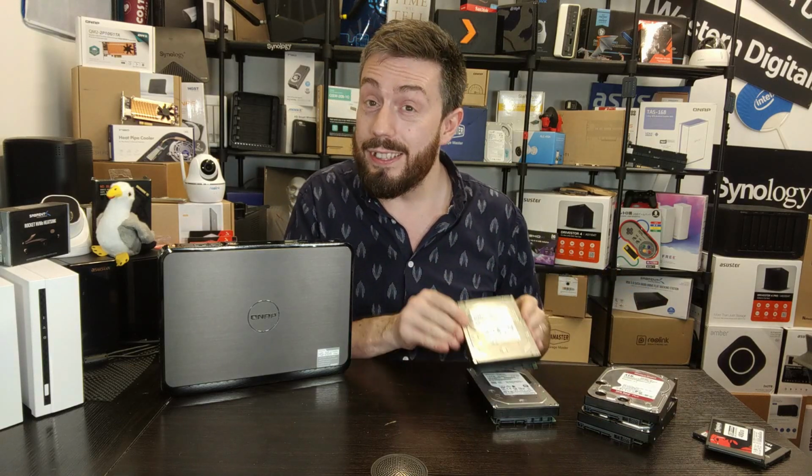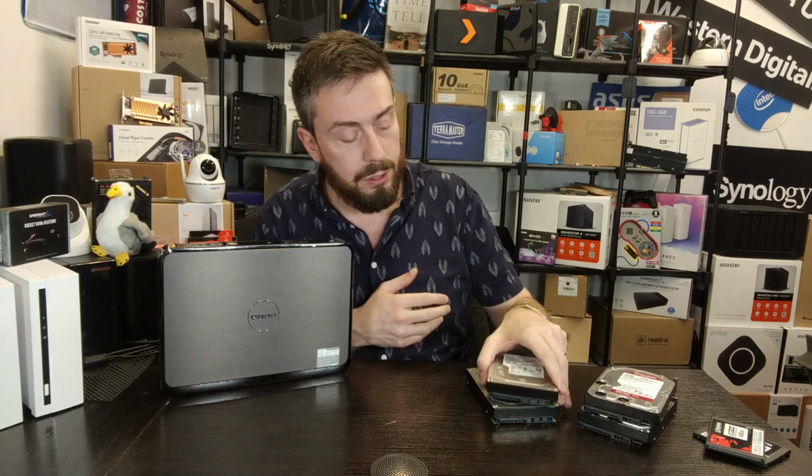And I'm going to be looking at data center class 10 TBs, which these days, given the way portfolios for a lot of hard drive manufacturing brands have changed, a lot of the time you can't buy drives greater than 10 to 12 TB without them being enterprise built because of the nature of hard drive development. They're all 7200 RPM, they're all helium sealed, they're all using quite industrial enterprise quality products inside there.